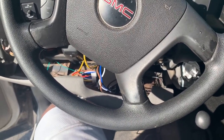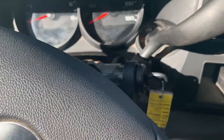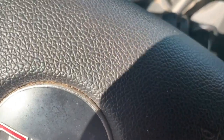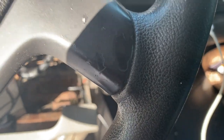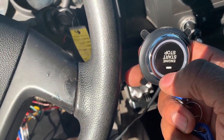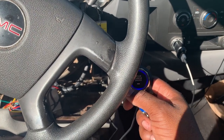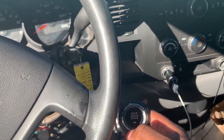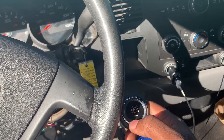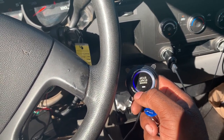We don't have to do any programming or anything. We just make sure our transponder is there and our key is in the ignition — but we're going to cut this key so that it stays unlocked. Let's put our key fob and transponder here. Foot on the brake, one, two, three — and everything started up. To stop the vehicle, just hit it once. Let's try it again: foot on the brake, one, two, three — and it started up.